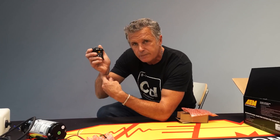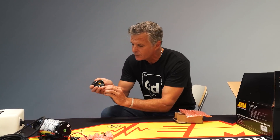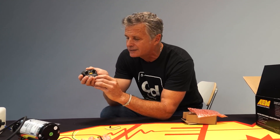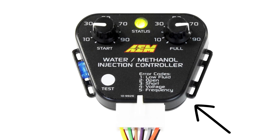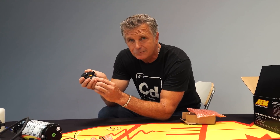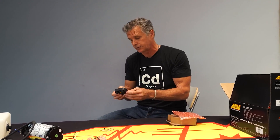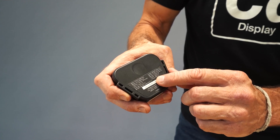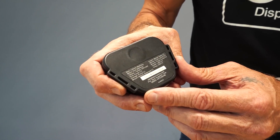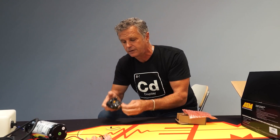We have two status lights — one mountable in the dash and one on the controller itself. In the event of something going sideways, whether you're running low on fluid, have a line fracture, or an open or short circuit, there are literally trouble codes in this with internal diagnostics. There's a nice little chart across the bottom showing what each error code means and how many flashes. Nine times out of ten you're going to be out of water and methanol, but this gives you diagnostic direction. On the back, you have all your color codes for wires and which component they connect to. There's also an external fuse — if something gets shorted out, everything is right here in one spot.